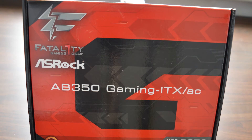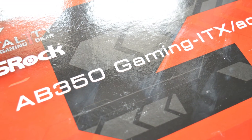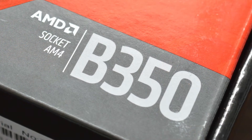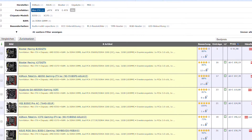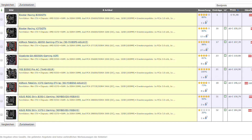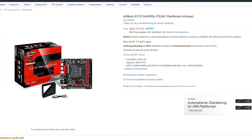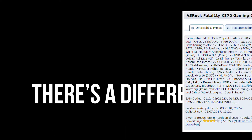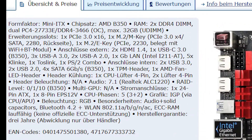As my main board of choice, I went with the ASRock Fatality AB350 Gaming ITX AC, featuring a B350 chipset. Since I want to go budget ITX on AM4, there isn't much room for discussion anyway, since there aren't that many options. Also, spending quite a lot more for the X370 chipset does nothing — well, actually there is a difference: while the X370 has its Type-C and one Type-A port as USB 3.1, the ones on the B350 are only 3.0.